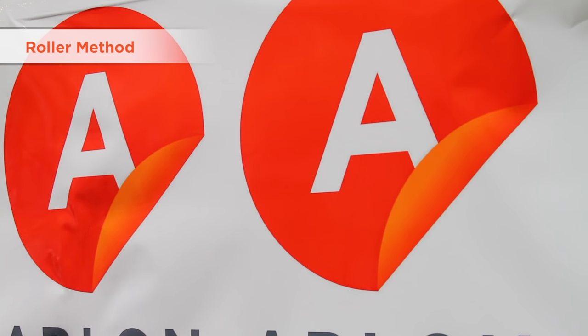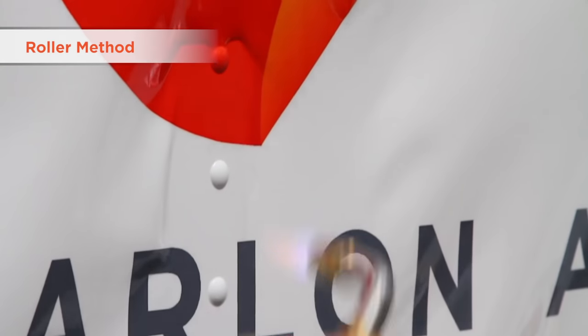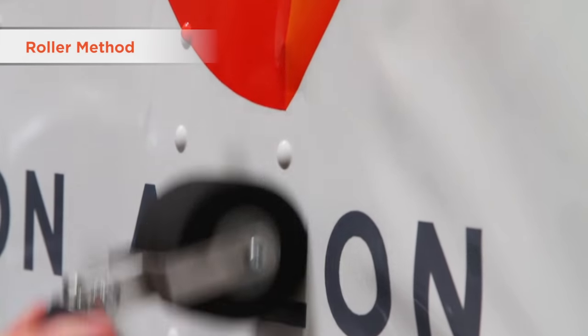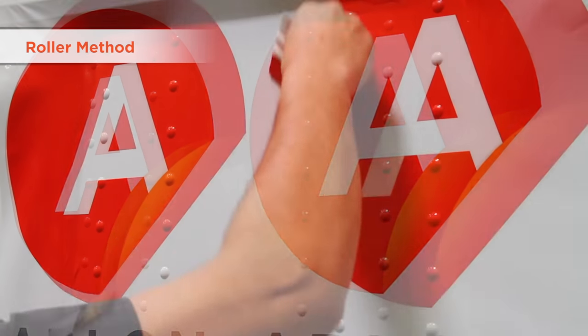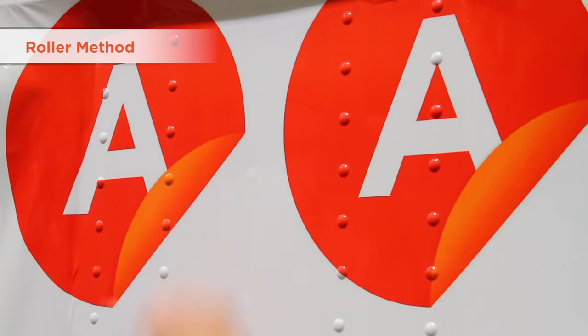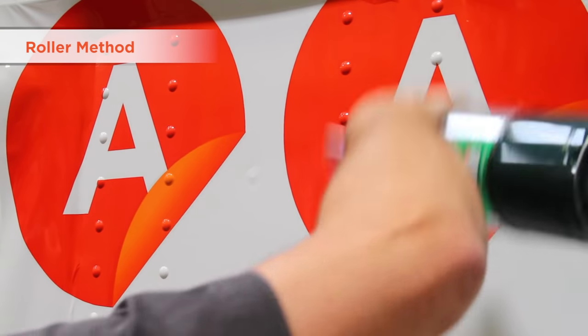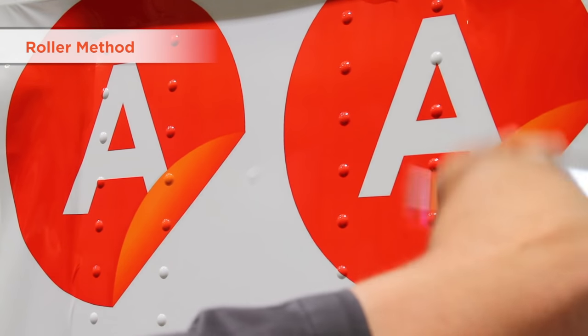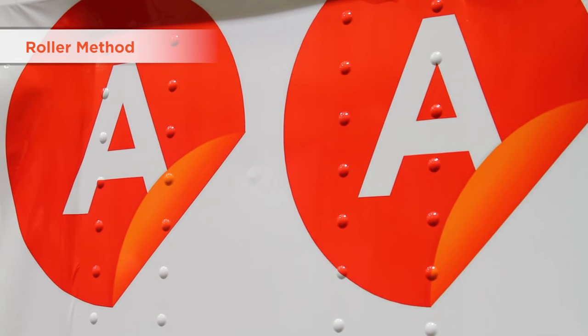Some installers prefer to set the rivets first. The technique is the same, just in reverse. Notice how both sets of double rivets are installed, but the flat area between is not. Now, simply install this area and the application is done. Sometimes the roller leaves a mottled texture around the rivets. A quick post heat will bring the original gloss level back to your graphic.